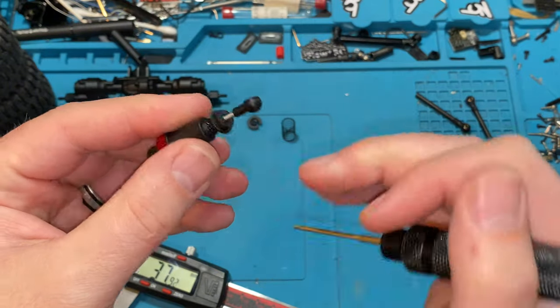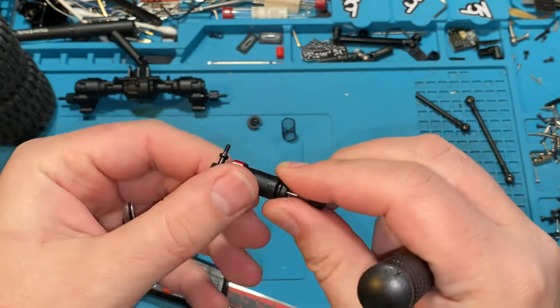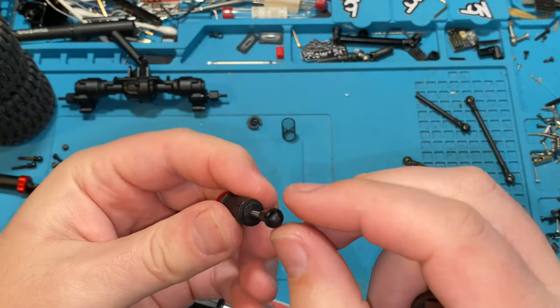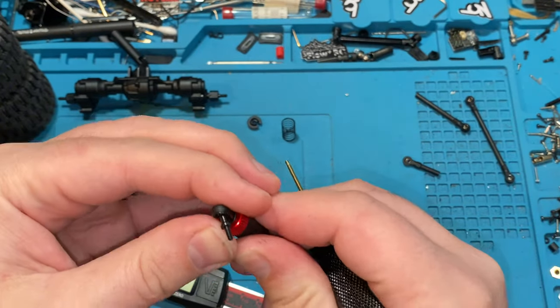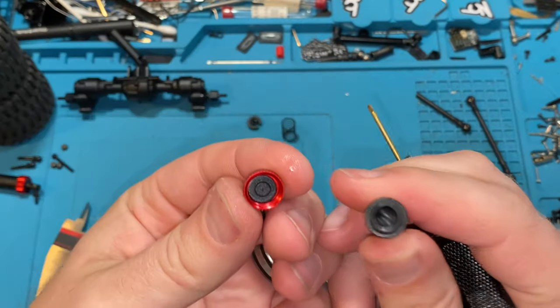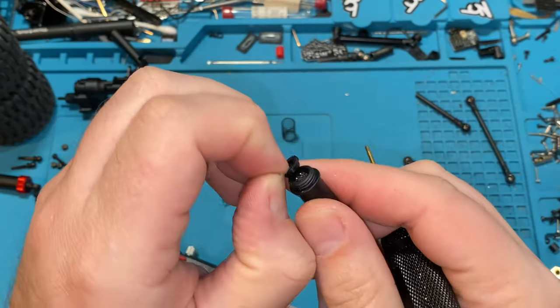I did see in one of the Facebook groups, somebody had their shocks leaking right out of the box. There was a little bit of leakage on the cardboard. But tolerance in the cap here is pretty good. So yeah, I don't know. Let's see what the top looks like here. And these are aluminum caps. There is a bladder, so that's nice. That helps prevent cavitation.